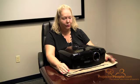To prolong lamp life, make sure wherever you have your projector — tabletop, shelf, or hanging from the ceiling — you've got plenty of airspace around it. We don't want it to get hot or for the lamp to overheat. The other tip is to have a power protector on your projector so you don't have power surges coming in and shortening the lamp life.